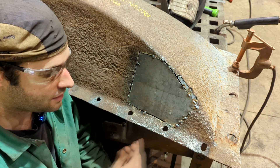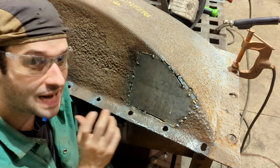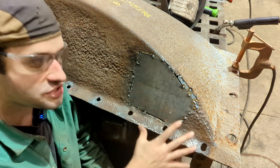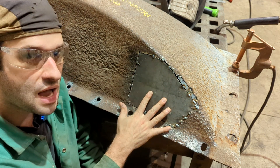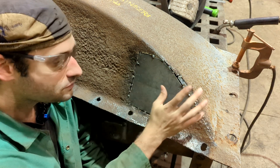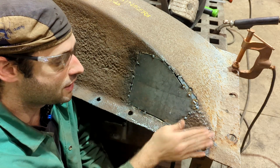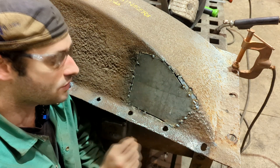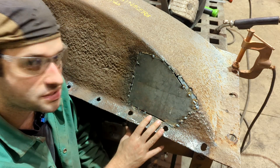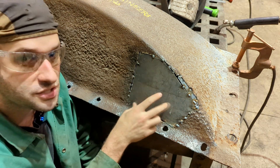I know a lot of people — I used to be like this when I first started — I'd think it looks really good, go to weld it, and by the time I got done it looked like an absolute mess, ruining all the work we just spent doing. This is going to be a two-sided repair, so I'm going to weld the outside and then the inside and polish both down. With this radius there are a couple of tricks for blending it to make it look like a nice hump. Also, because we're welding rusty metal on the outside edges, you might be tempted to turn your heat up — don't. Run a little bit colder so you don't blow through any thin spots on the outside.